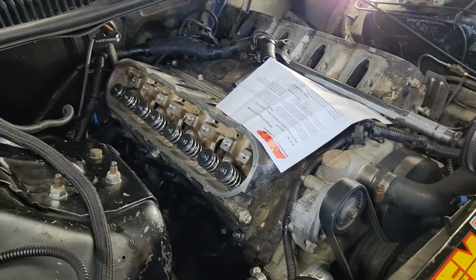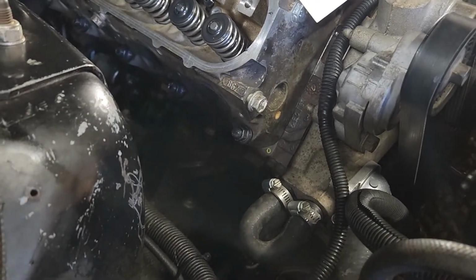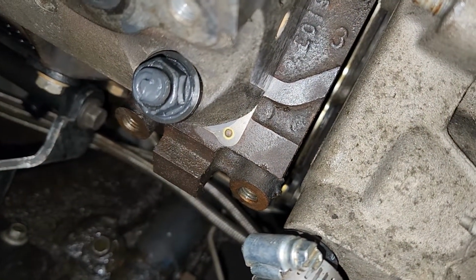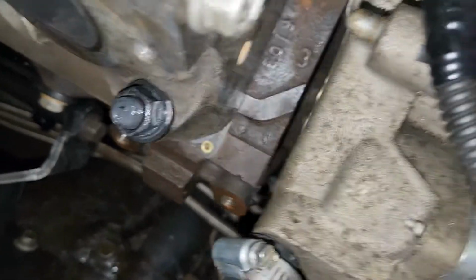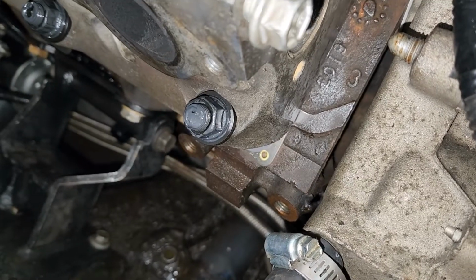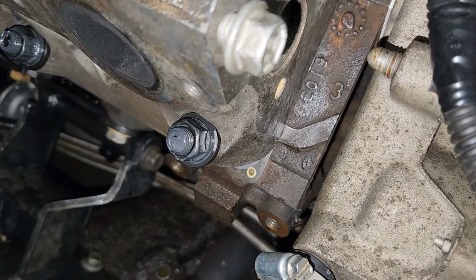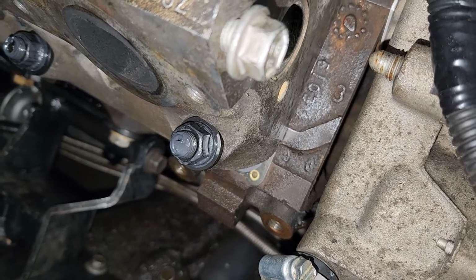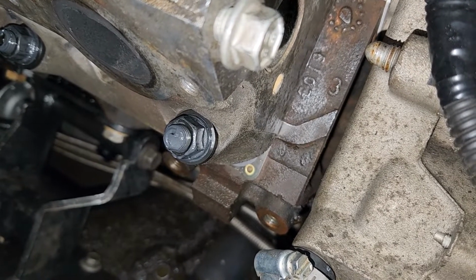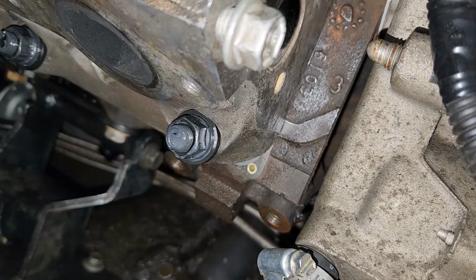So the ones I had before, it actually even looked like it cracked. I mean, it smushed the washers. See, you got the washers that go below the stud. Now, on these right here, and I always wondered why they never made these like this, but that washer isn't supposed to spin. The nut's supposed to spin on the washer, and the washer is supposed to stay on the head. So these washers, every stud I've ever done, they're smooth on the bottom. Well, these ain't. These got like little things that'll grip the head and help it keep from spinning, which is really cool. It really helps.